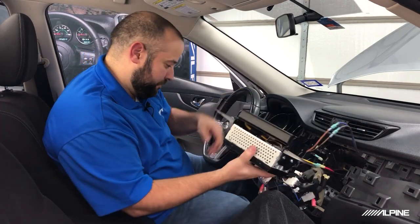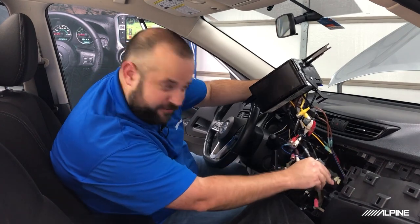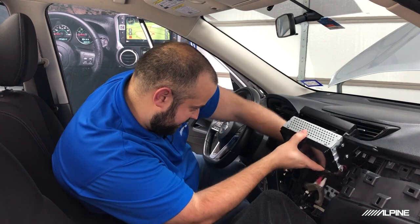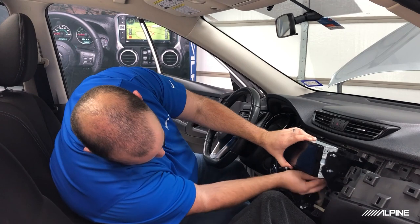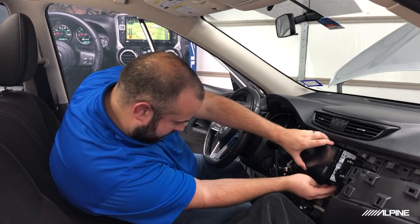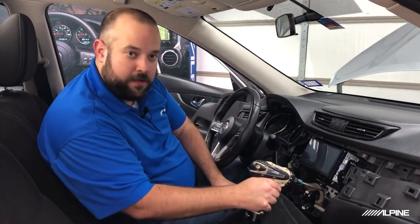All right. So once you get all your connections done, I always just kind of give it a once over to make sure I didn't forget anything. It looks like we're all good, so we're just going to tuck everything back in the dash. Make sure all the cables are running out of the back underneath the radio here. And then we're just going to screw it in. All right, so next step is to go out under the hood and make our connection at the battery, and then make sure to get the ground connection hooked back up, and we're gonna start testing everything.